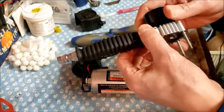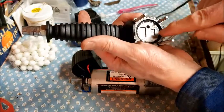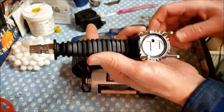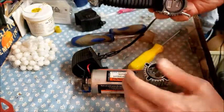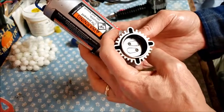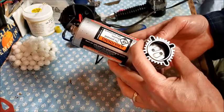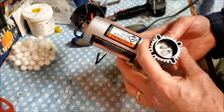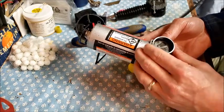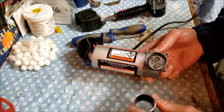So you can see that there's a seal right around here, and there's a couple of valves, it looks like, on the piston itself that obviously open and close so that the piston will allow the air to be compressed. They act like check valves. And so this is just a cooling ring, it looks like. And this is actually the piston sleeve, which comes off like so.